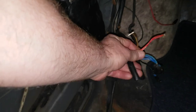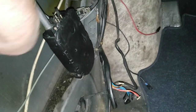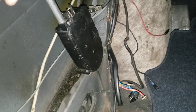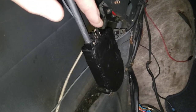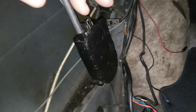I took the wiring harness apart. Here's your ground, here's your power. If you connect your ground to the ground pin — which is right back there — connect the power there, and connect a trouble light up there to the battery, the trouble light comes on. So we still have a parasitic draw. Either I have two bad antennas with the same problem, or there's an issue in the wiring harness somewhere else.